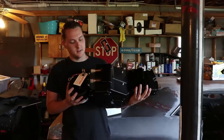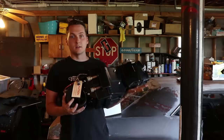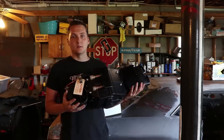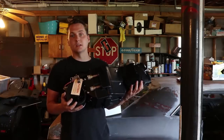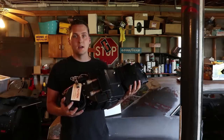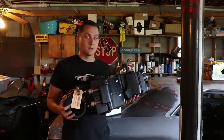Check out this beauty. This is their AC kit for a 1970–74 Challenger or Cuda with non-AC from the factory, because the factory firewalls were different depending on if you had air or not, as well as the dash and a couple other components. So this is going to bolt into a non-air conditioning car and have everything you need. Before we deep dive into what we have here in this air box, let's take out our old one so we can make room for the new one.